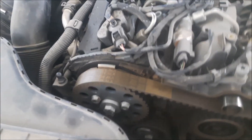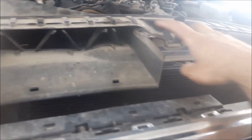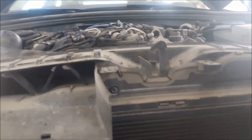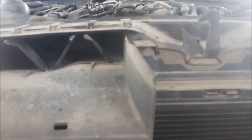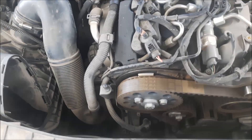I'm going to have to remove this plastic pipe that goes to the air filter housing, but to remove it I have to remove the plastic cover on top of the coolant radiators. I have removed the plastic cover — there are only two plastic fast pins. There is one bolt holding the plastic pipe and another one here. They are Torx 25. Now I have more access for the camshaft.